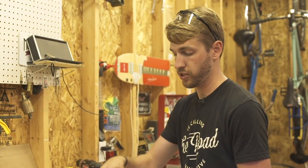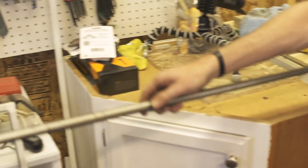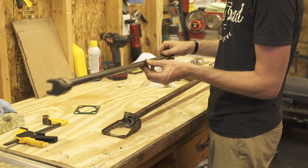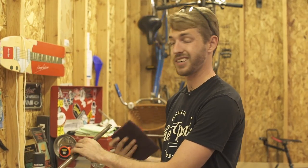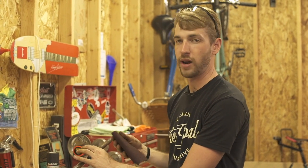Now that we've got everything off the opposite end at the transmission, we can actually slide this shaft out — you have to rotate it a little bit and it pulls nice and clean. It's actually fairly lightweight, has a decent amount of stiffness to it, but we're going to have to clean up everything on both ends. From this end we'll remove all the old grease, and on the other end we'll clean off all of the rust and make sure we've got a good surface for our new billet shift piece. It's basically surface rust. You could use a small die grinder or light sandpaper, but personally I don't like pulling out the power tools for a small job like this — I just use red Scotch Brite.